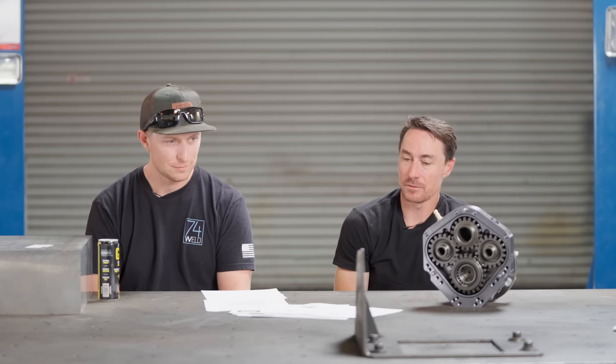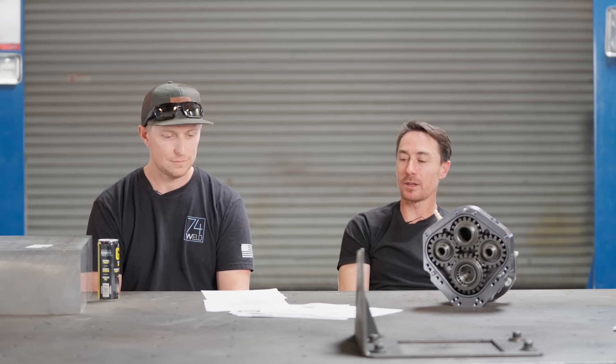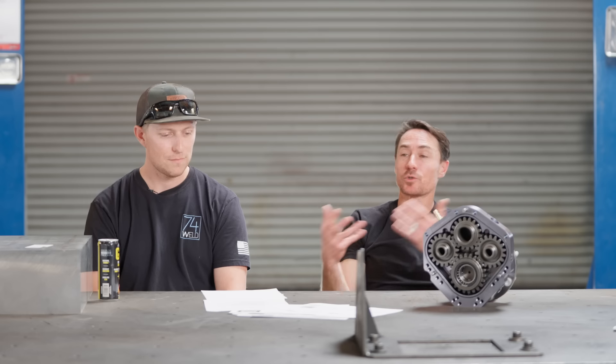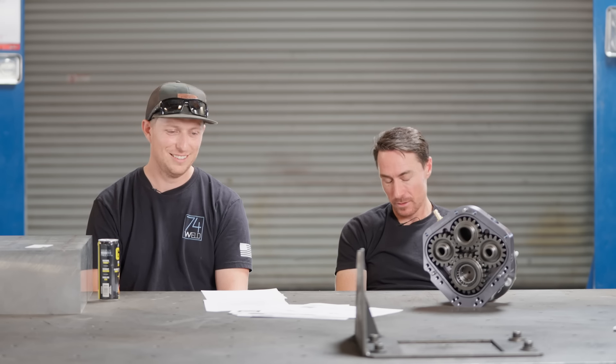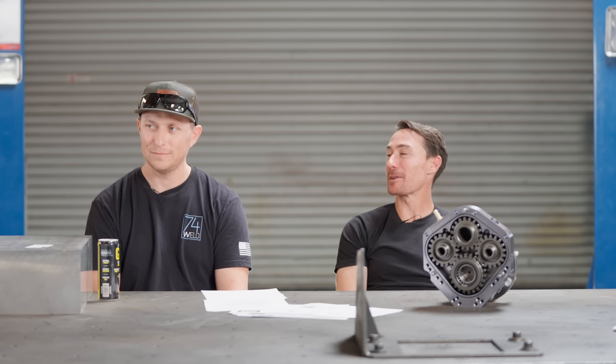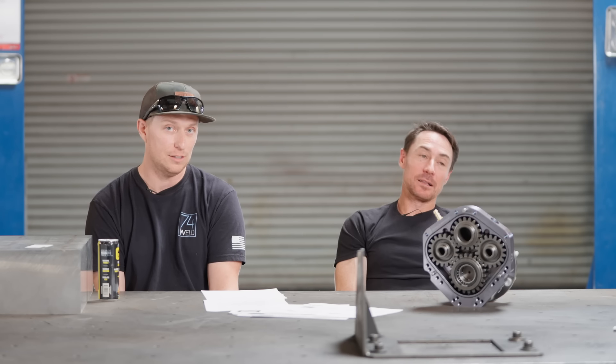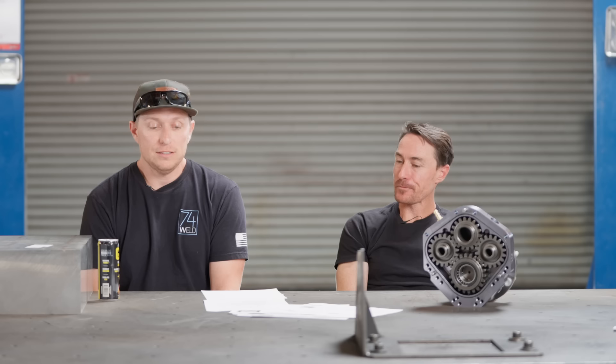On JLs, if you put a big enough tire on there's a reason why there's a steering box brace. If you have 40-inch tires and have a buddy turn the steering wheel back and forth while you watch from underneath, you will physically watch the frame flex in and out — that's super sketchy. Companies make braces for that. That was partly why I went to hydro assist — I was scared to tear my steering box off the frame. OEMs are going thinner on everything to save weight for fuel economy standards.